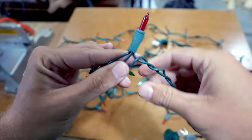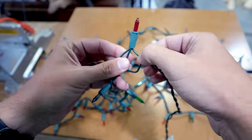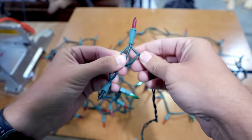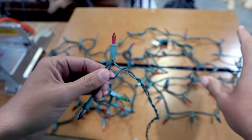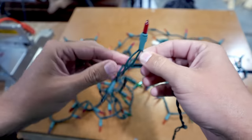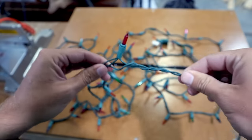You've got your two wires coming out of the plug, which is very normal. Then we get to the first light, and all of a sudden we have three wires. If you notice, one of the two wires coming from the plug does not go into this light — one wire goes into the socket, and then we have two coming out of the bottom of the socket. This is a junction. This is why when half the strand is out, the other half can still be working, because one of the wires coming out of the bottom does not connect to this light — it just goes on to the beginning of the second half. You essentially have two sets of lights hooked up to one strand, each on their own circuits.